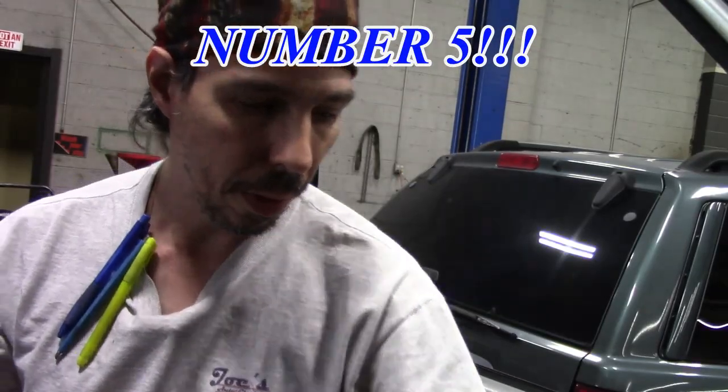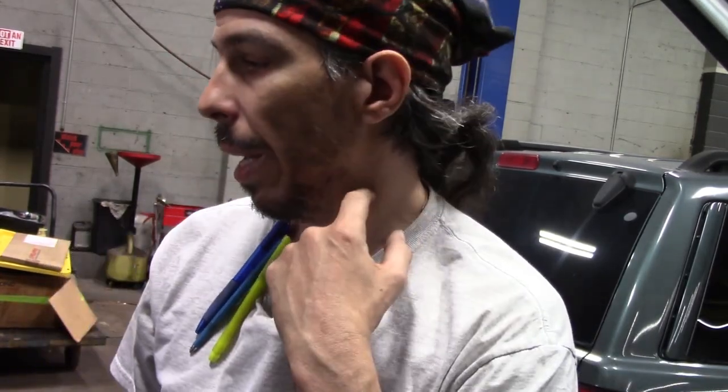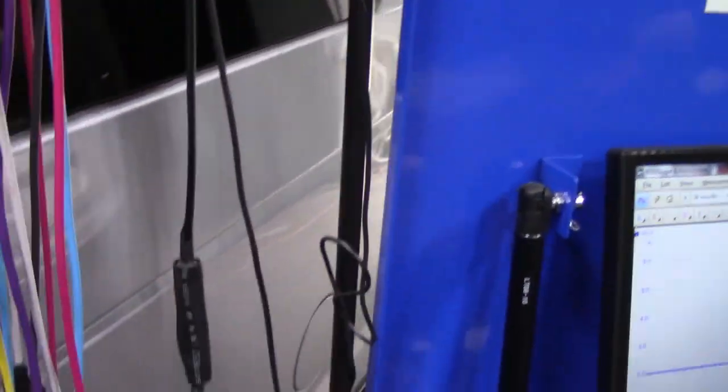Now you're going to have your feed side. That's where the current clamp is. The trigger, or the wire coming from the computer to the coil to trigger it, that's the side that I'm on with my other channel. All right, now I'm looking at primary voltage, so let me go a little further here and show you our setup.